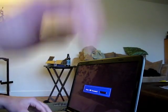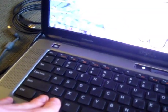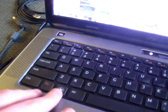We enter in our hard drive password — look away. Now that we're in Windows, hold down the Microsoft key and the function key, then press insert. Technically, we just pushed the Windows key and Break — you have to hold down the function key to do this. Now go right here — installed memory: sixteen gigabytes. Perfect.